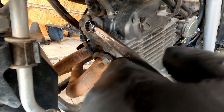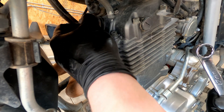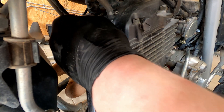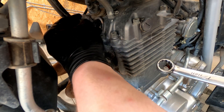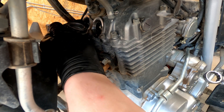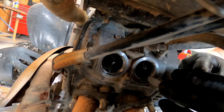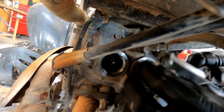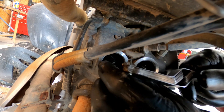To adjust the exhaust rocker arms, there are two access plugs here on the back — a 17 millimeter wrench gets those off, pretty straightforward. The challenge with these back exhaust adjusters is there is really limited access. You can get these plugs out no problem, but then you've just got this little hole to work with to make your adjustments. The adjustment for the back is the exact same concept as the front — feeler gauge measurement, jam nut — but it's really snug because of how small the access is. Checking this first one, the feeler gauge goes in and is snug with no excessive movement, so this one doesn't need any adjustment.